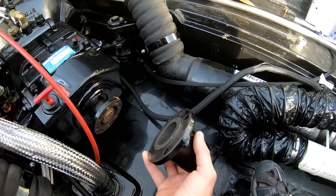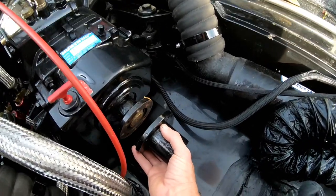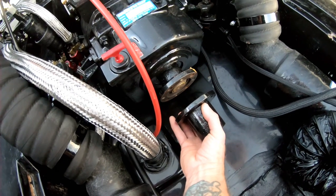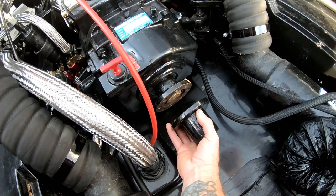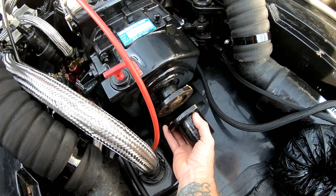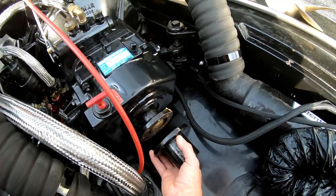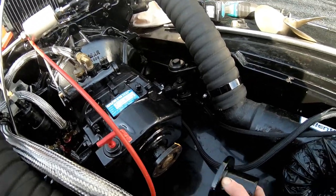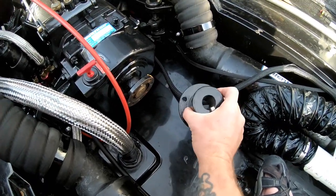So other YouTube videos will go into this, but basically put a socket in between down here and then put in some bolts and then slowly snug that up and give it some taps with a dead blow hammer, and eventually this will pop off the end of the shaft. That was actually the most work of this project.